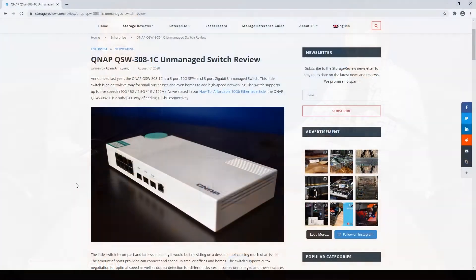A lot of these vendors — if you look at Synology right now — have platforms with one RJ-45 port, two or four that are just 1 gig, and you really have to aggregate them, do multi-pathing to take advantage of higher bandwidth. With this device, you have two ports that can each be faster than four 1 gig ports combined. We posted the review recently, and we ran some numbers to show, with this system, one gig versus two and a half gig.